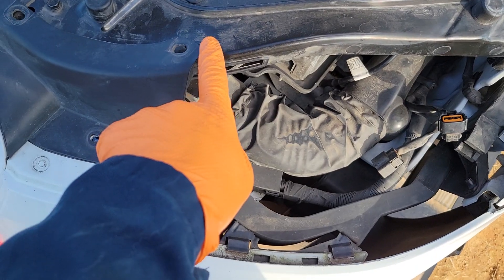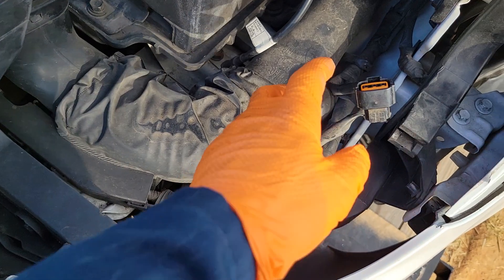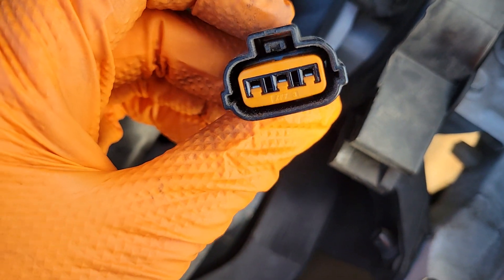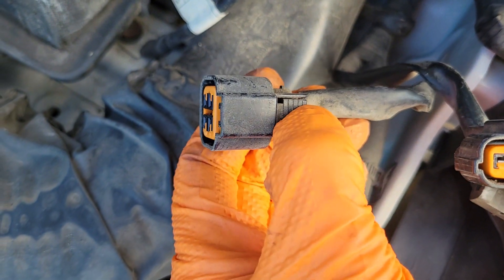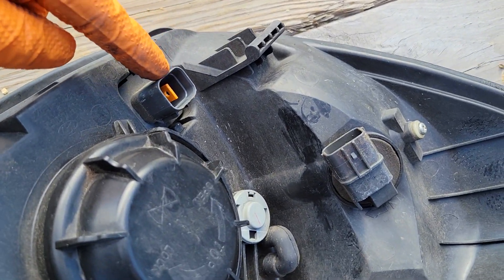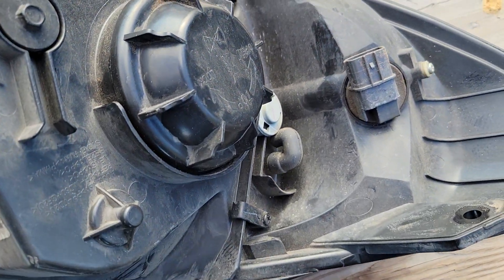After that's disconnected, take this bolt off, that bolt, pull your light out. You have two plugs — press this tab, which allows it to be removed, and then you just pull it down. Same goes here — you just press here and pull out. Those are the two connectors, and that gets your light out.